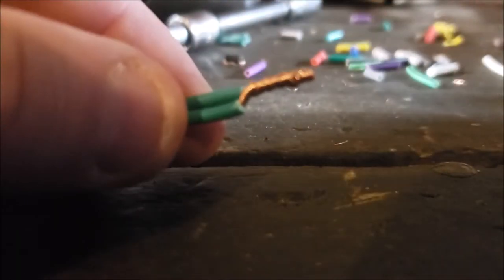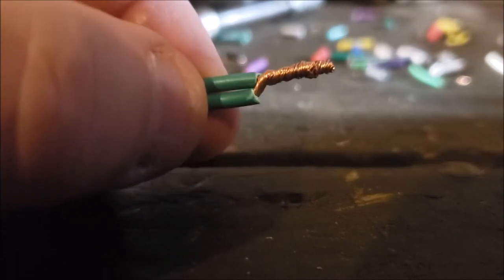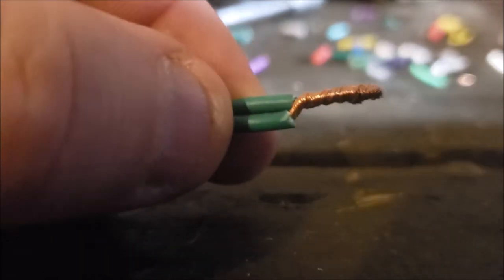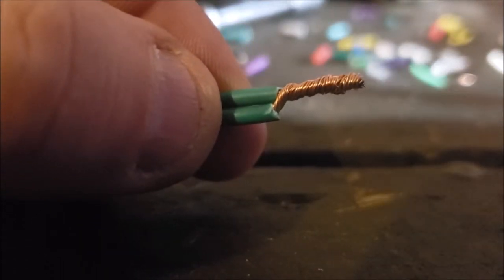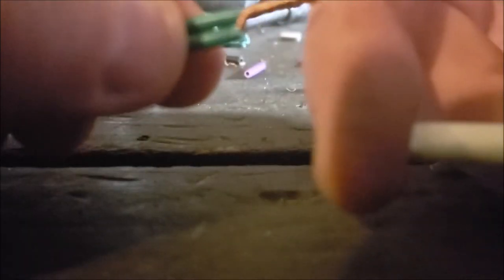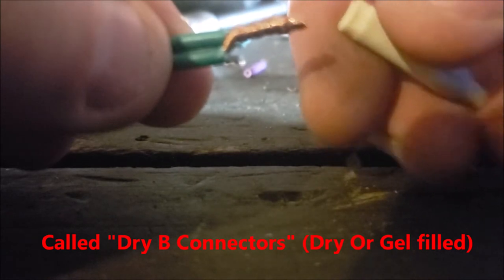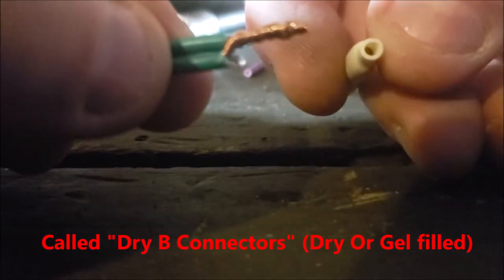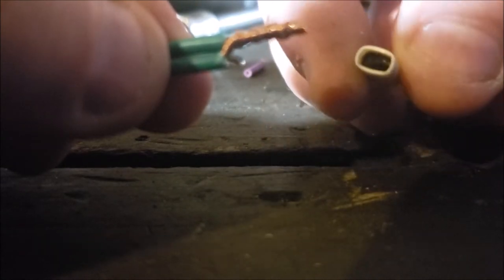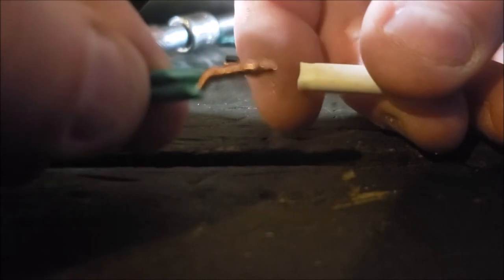Okay, now as far as putting it together, you're not going to use a butt splice. I mean, you could, but I like getting it twisted like this and having really good contact. What I've found, telephone crimpers, okay? They work great, like for telephone wire. I'll see if I can find a link, because that's kind of a commercial product. You don't just get that at the store, and I'll post it now.